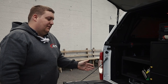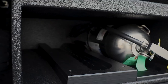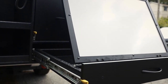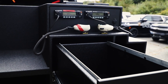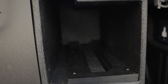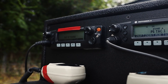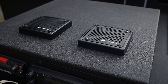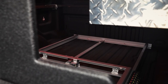Taking a look at the back, we have a custom-designed slide-out command cabinet. Thousand-pound SlideMaster with the IMS lock. We've got our extinguisher wedges cut in, a ratcheting magnetic command board, file drawer, small compartment or another extinguisher if you'd like, small equipment, Knox box, two radios, USB outlets. We installed recess-mounted our speakers to the top to keep them out of the way — still able to hear it — and it all comes out with the SlideMaster.